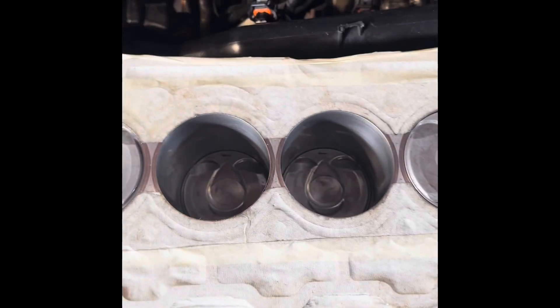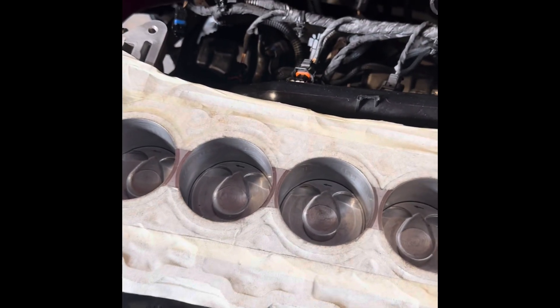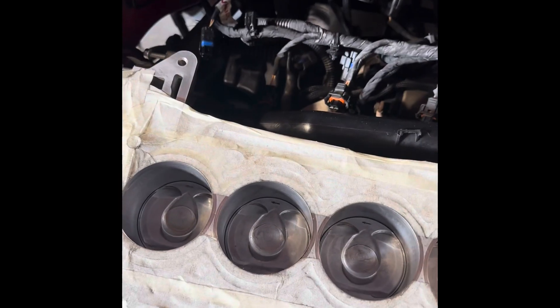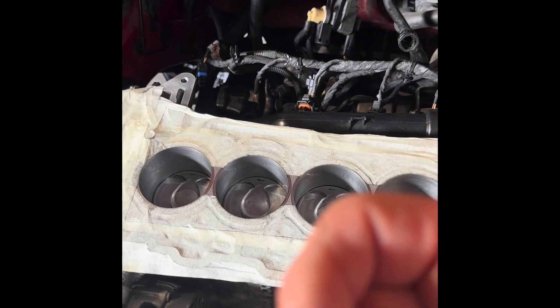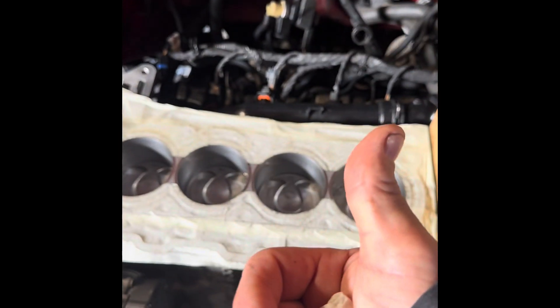The four pistons are in. Just to double check, I've got on the crank here — we can see how it's looking on the bores, taking it all down. Looking good — it's all nice and free as it should be. So I'm putting that in the middle, so they're all about mid-stroke. Now I can find the locking pin on the crank and put that back in. The crank's all set, ready to put the head on. Before that, I'm going to put a new chain on the oil pump. So this video is basically about how to put the pistons into the Mini N14. Hope this video has helped someone — if you like the channel, subscribe. We're always doing stuff with engines and fixing things. Get yourself in a situation — you can do it.